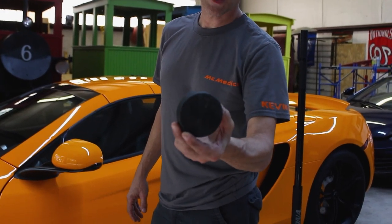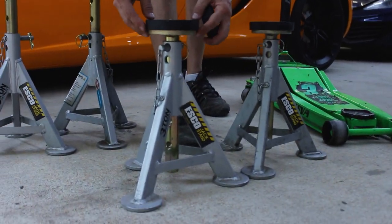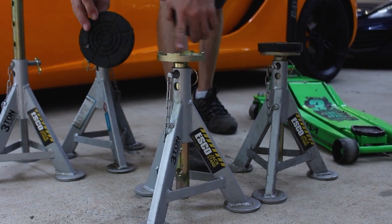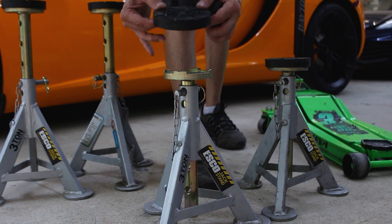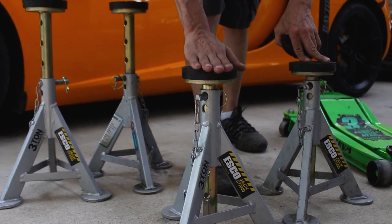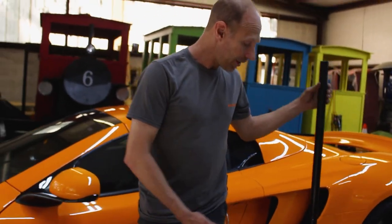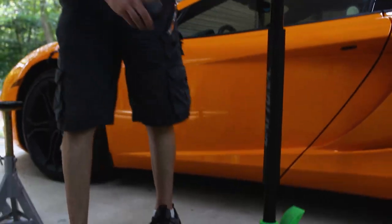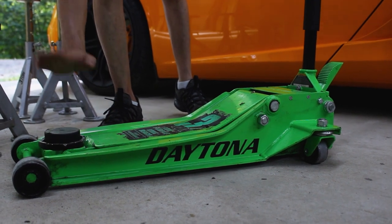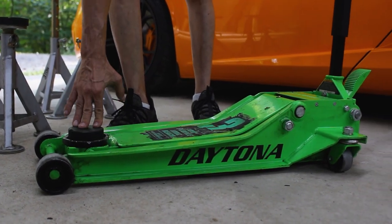First, in my hand — some of you may have recognized a hockey puck. These cost a dollar or two on Amazon. We've also got a couple of ESCO brand jack stands, which are unique in that they have a rubber pad and a circular top built in. This is really carbon fiber tub-friendly — it creates a friction surface so the smooth carbon tub doesn't slide, especially as you're jacking and loading or unloading the car at different angles. And of course, we've got the Harbor Freight Special — a very inexpensive floor jack, maybe $230 — but it's low profile, long reach, and that's going to be important. The hockey puck gives us a nice friction surface between the metal of the floor jack and the bottom of the carbon fiber tub.